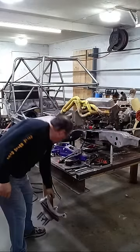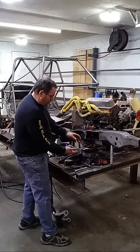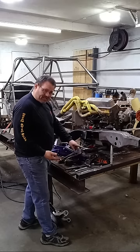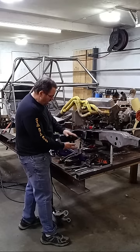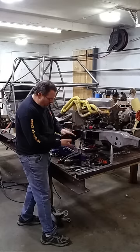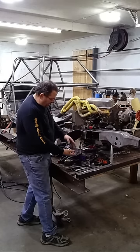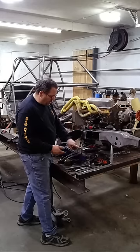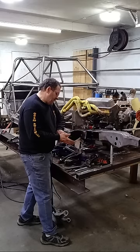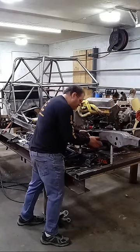We got to talk about where we're at in ride height and where this curve is in the bottom, and the reason we're running a half-inch extension right here is to lower the ride height of the car, because we're trying to put this lower control arm right through the middle of level as it works through it. And as we come up further and further, if we're running a stock ball joint but a real low ride height, now that we're way up in this curve, it's actually moving the spindle in toward the car, and that's creating this exaggerated bump issue.